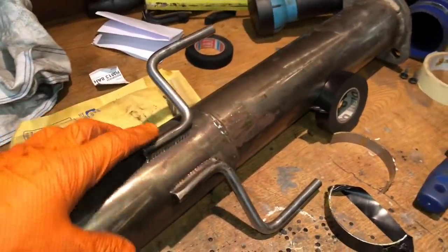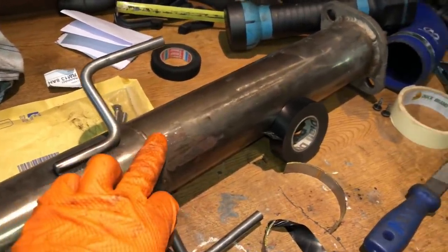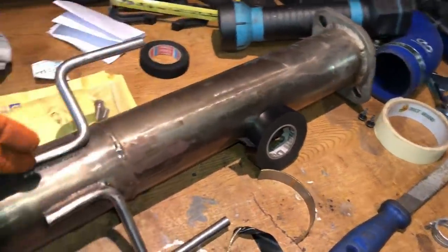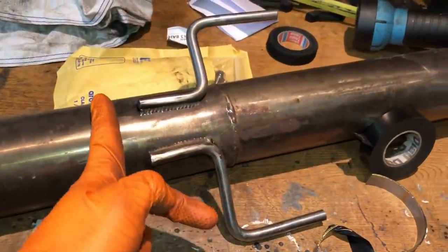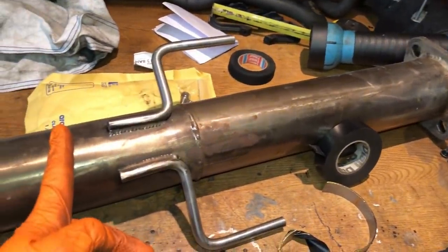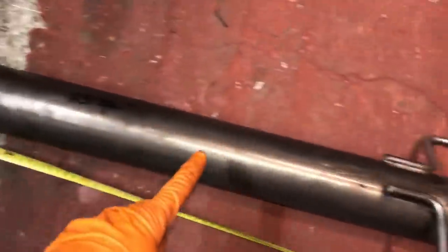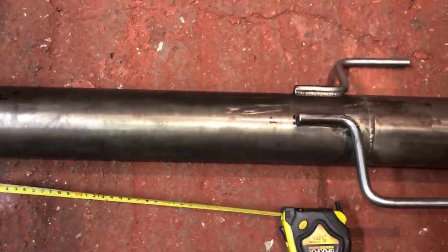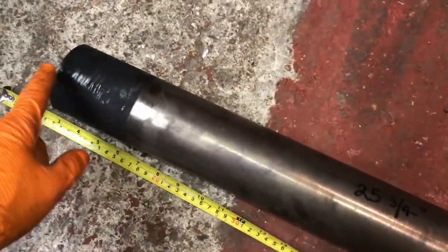This section has had quite a bit of modifying in the past. I built it for a big turbo car, then went back to a small turbo, then had to add a section and weld on a different flange. Instead of remaking the whole section, I'll just cut it here to save a lot of hassle. I've measured the total length from here to the bracket — 25 and three-quarter inches — so when I put this silencer in I just need to make this section 25 and three-quarter inches and it will slot straight back in perfectly.